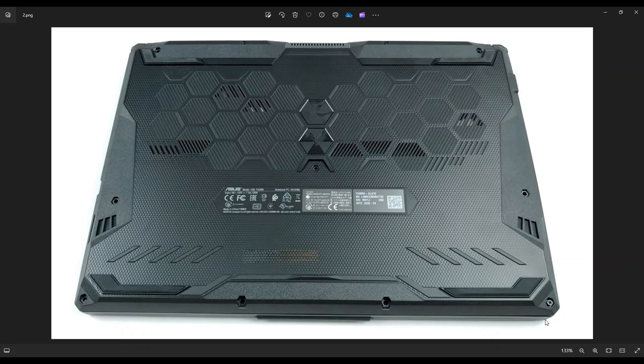You would then use a small, flat, preferably plastic pry tool. I say plastic because metal pry tools tend to scratch your case a little bit. Use a small, flat plastic pry tool to finish this off. Start over here and go around the edge of your bottom case until you can pry the whole bottom case off — nice and slow but firm. Don't put your pry tool too far in; you could damage some things. Just keep it right on the edge and go nice and slow.